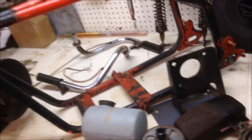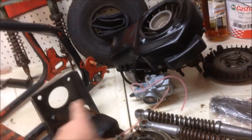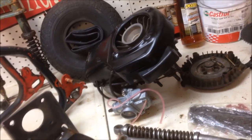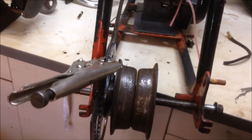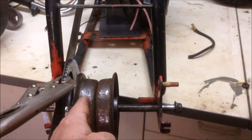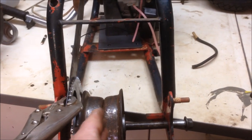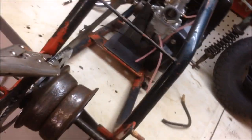The goal today is I want to have paint on this frame, but I've still got to finish dummying it up. I'm going to assemble it now — I need to make sure my chain line's up with my sprocket. That's the main thing I'll do before I paint it. The starter, tubes, tyres, rims, detailing — it doesn't really matter too much, but I want to get the frame painted. So I remember there was an issue with the spacing: if I line up my sprocket with the clutch in the original mounting holes, because this isn't an original Dexan hub — which, when I bought it I was told it was, but that's a story for another day — my wheel sits right over to the left-hand side. I need to bring it to the centre, which means I've got to move that motor right over. Let's do some tweaking and see what we can do — it's going to stick out a lot, but it is what it is.